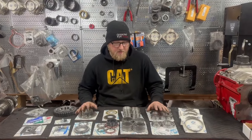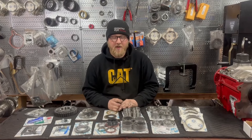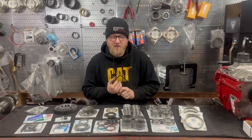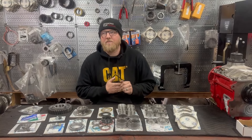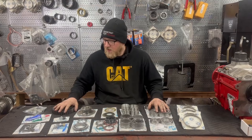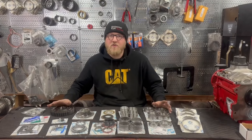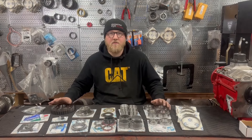I think that's pretty much it. The only thing I did want to touch on is that Jesse advised me there are going to be several drop-down options with this kit. If you need commonly replaced items like an input shaft, a main shaft, or sliders — sliders are a really big thing — usually with every rebuild we'll put at least one slider in and at least one or two outer synchronizer rings. Those are all going to be drop-down menus. So if you tear down your transmission first before placing this order, you'll know exactly what you need to swap out. I highly encourage guys to get at least one slider and at least a couple blocker rings — you're probably going to need an input shaft. Some other hard parts will also have the option to be added on. This is the only place where you can get a one-stop shop, one part number, one swipe of the card. This is all the things I use in my professional rebuilds that are still out there kicking, towing, and working heavy year after year.